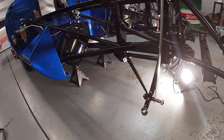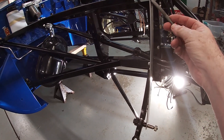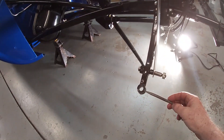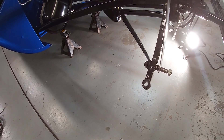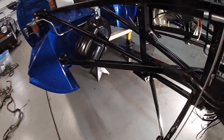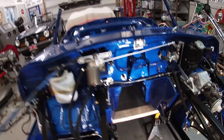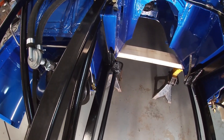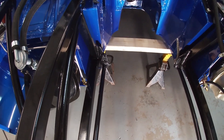I have this set at the right length for my car. This check dimension from the top of the picture frame to the tip of that ball joint locator is 20 and a half inches. I had a feeling that my torsion bars were off, and this is the corresponding position.